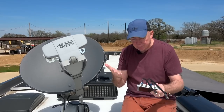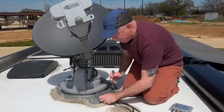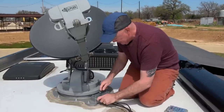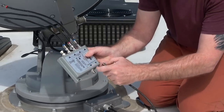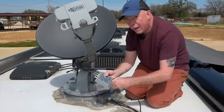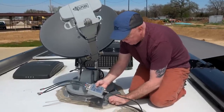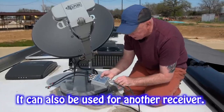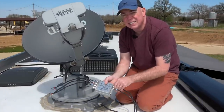So what do you do? Simple as this. You take off your wires here — that's only two coming up to the top of the coach. And then you take wire number one and you want to put it into number one on here, which is the second port. You always want to make sure because that's where the power is going to go in from downstairs. So cable one into slot one. You actually don't need cable two, but I'm going to put it on here anyway just to keep it watertight and protect that cable in case I ever have to use it for a backup.